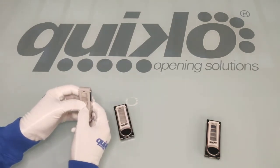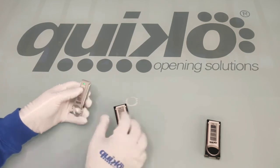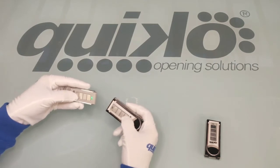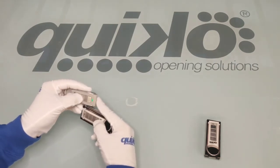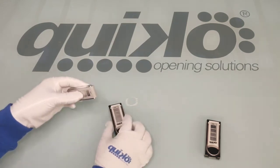Here it is. Press the 3rd and 4th button simultaneously, LED starts flashing. Let's say I want to copy the 4th button of the old remote — I press it. The LED stays stable and then I press the 3rd button to copy the signal onto the 3rd button of the new remote.